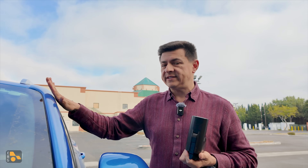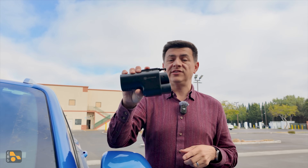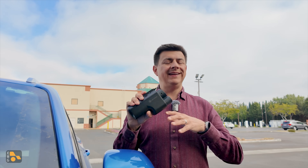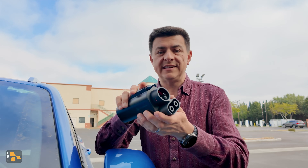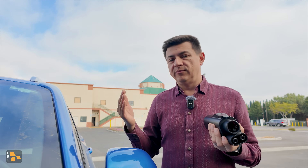The Ford adapter is a Tesla NACS-to-CCS adapter — it's about two inches shorter than this and not built quite as well as the Lectron adapter. On the GM side, which adapter you get depends on which EV you have. For a Chevy Bolt you get the Lectron; for a Blazer EV it looks like you get the Tesla adapter. They function exactly the same — it's just adapting pins from one side to the other, with thermal switches inside to cut power if things overheat.